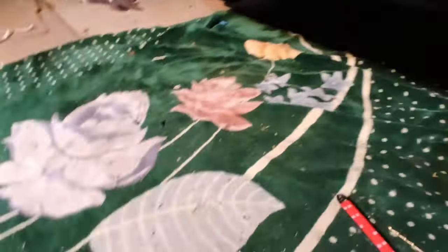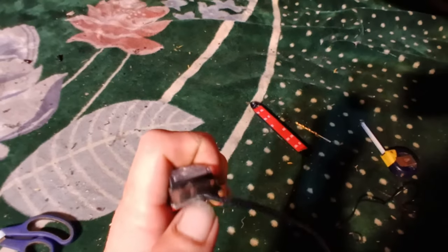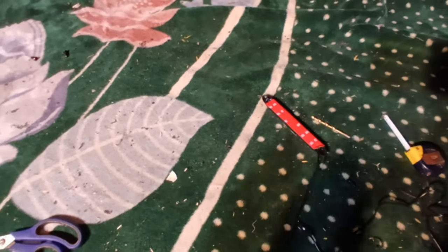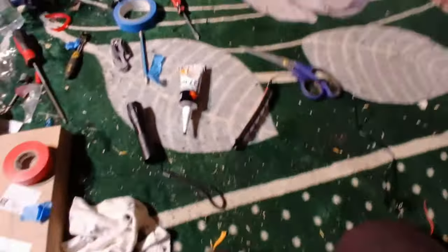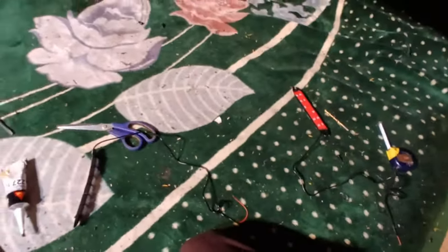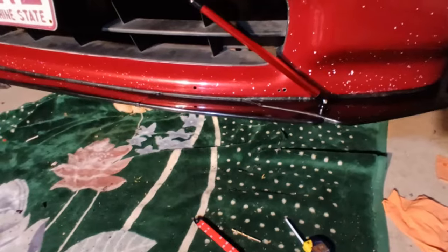Now I'm not exactly sure that these are 100% waterproof, so if you look down in there, water can access through that little hole where the wire is. So for a bit of a safeguard, I'm gonna stick a bit of that stuff in each end, because if I pull this end back a bit, you'll see there is a hole. Same thing for another wire. So stick a bit of that stuff down in the guts each end and hopefully do the trick. Okay. And bolt these on and then work out where I'm gonna run wires to wire it up.